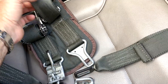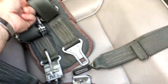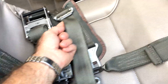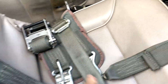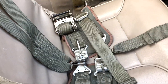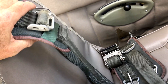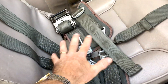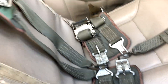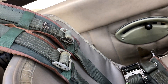So get these front two belts — right and left — as tight as you can by forcing them down into your thigh muscle with one hand and taking the slack out through the slip buckle. That is a footnote to the proper use of the front belt. The shoulder harnesses are absolutely not intended to hold you in your seat, even on inverted work — that is all done from the hip belts, from the hip bones and your thighs. These over-the-shoulder belts simply keep you from hitting the panel during sudden stoppage.